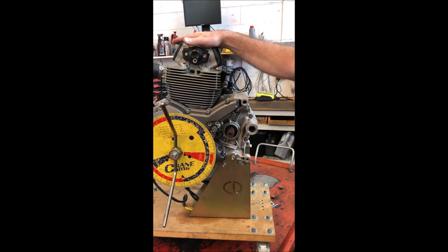The first time we saw it was on a S2R1000. We did a first service on one, and back in those days we used to adjust belt tension every service. The DS engines had initially had a belt tension spec of 140 hertz, which we used to use. We did it to this S2R1000 and the guy came back a couple of hours later saying it was making a horrid noise. We rang up the importers in Sydney and the fix was to loosen the belts off until the noise stopped — generally about 100 hertz on these engines. If you go much over 100 you'll start to get noise when they get really hot.